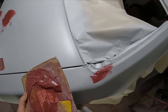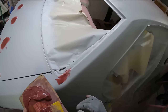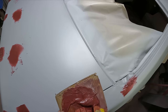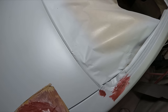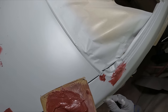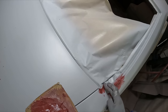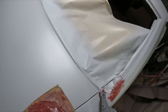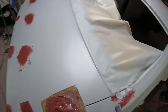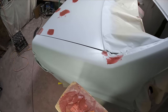All the metal was treated and cleaned right up. You can see there were a few little bits of pitted rust but it got treated and cleaned up properly. This stage doesn't have to be perfect either — it's all going to come out. You get that 40 grit or coarse sandpaper onto this and it rips it out in no time. I'll probably do a quick orbital over with some 80 grit and then reapply a full skin of body filler.